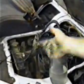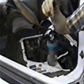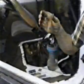With the vacuum gas and everything else, you have to have gas to motor usage, intake of air and gas, to the exact fine critical point. It's a hair whisker line, the same as the distributor. When you cut off your petrol and go to your gas, on petrol you can turn your distributor like that and it hardly does anything to your motor. When you put the gas on, you move it minimally, not even the width of a piece of foam and paper, and your motor will shake like anything either way. You have to hit that exact point or else you won't get your efficiency, you won't get your motor to run.